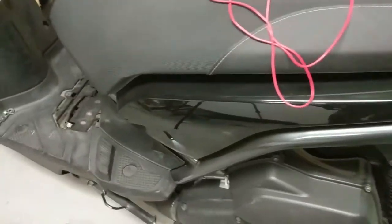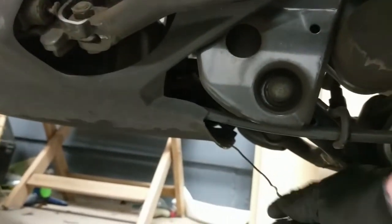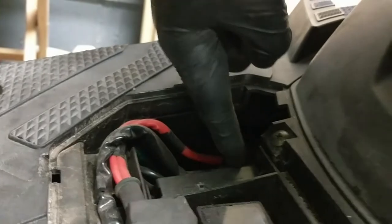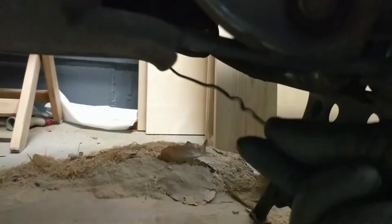The way to run the wire is: I just took a coat hanger and jammed it down into this slot here where the rest of the wires are running through, then curved it around the back of this piece and it came out on the bottom of the scooter. You can see it poking out here. The battery box is essentially just right under that, so what we're going to do is connect the live wire into this junction, run it through that hole into the base of the scooter, and then tie it onto this wire with some duct tape, and pull that wire all the way back up to where the horn is.